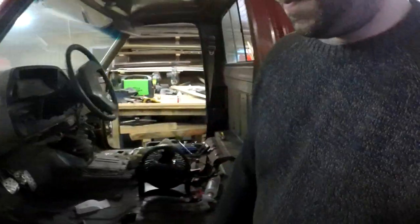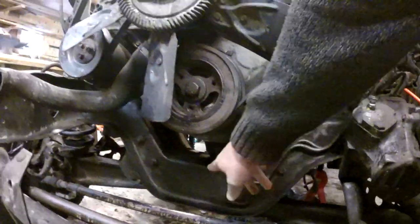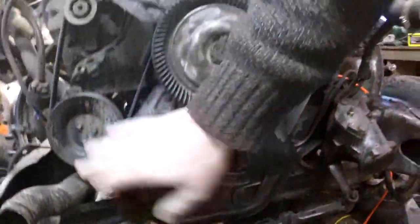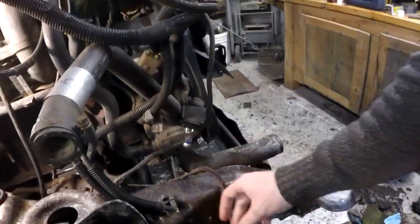Finally done with the cleaning - not the truck, but the frame. This is the next day, no heater, it's cold. I finally got the brushing and cleaning of the frame done. Everything's off, the frame's been completely brushed, even underneath, and I OSPHO'd the engine too. I might have to replace these belts anyway. The frame's basically been degreased and OSPHO'd.